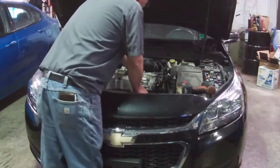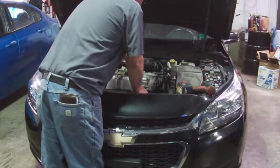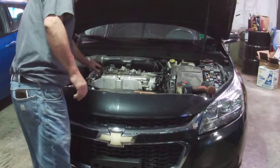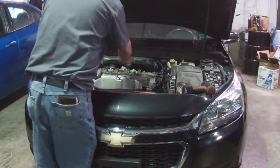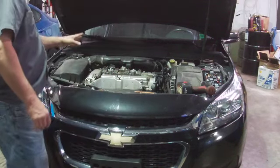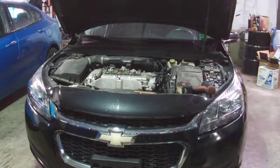This is the exhaust side, that's the intake side. That is the side that actually has control from this actuator, not the exhaust. The exhaust and intake timing advance through the VVT system is up here, and both have it, but the high and low lift for the rocker is only activated on the intake side. Sorry if I'm not getting much in the capture.